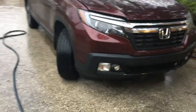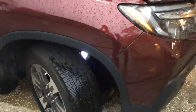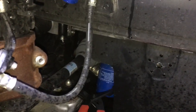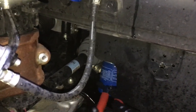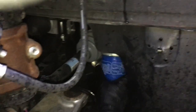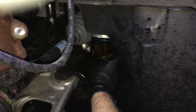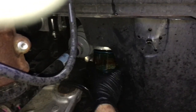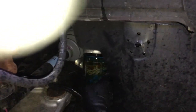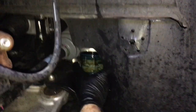If you're doing the oil change and taking the filter off, you do not need to put a jack under your Honda — everything's accessible. The key though is before you turn the engine off, turn your wheels hard to the right, and then the filter is right here, very accessible. Put your wrench on it and give it a little tug — you can see it comes off really easy. Reach in with your hands to do the last of it. If you don't like all this oil, it's best to drain the oil pan the night before; then the next morning when you take the filter off it'll be depressurized and you won't have any mess. But if you're in a hurry, here you go.